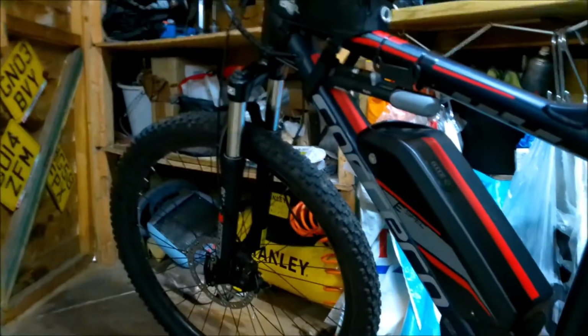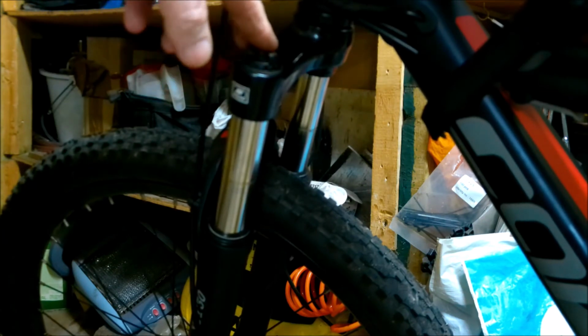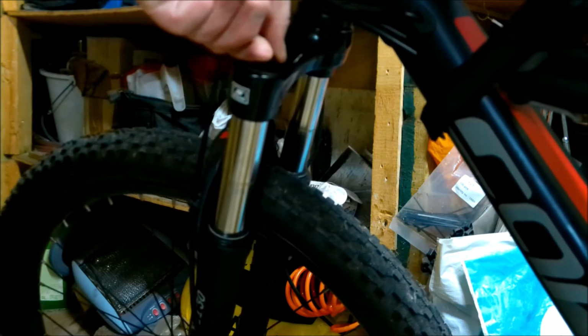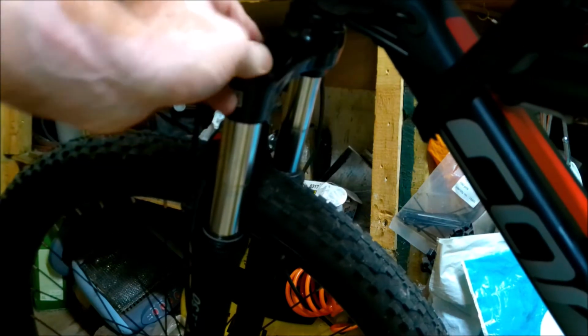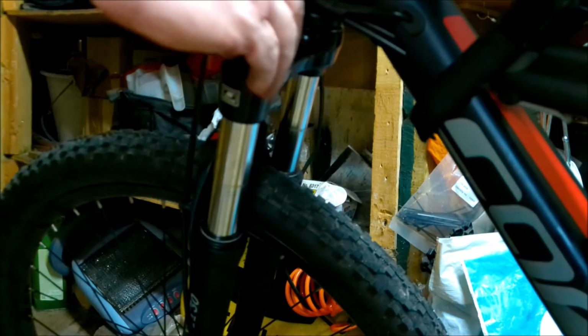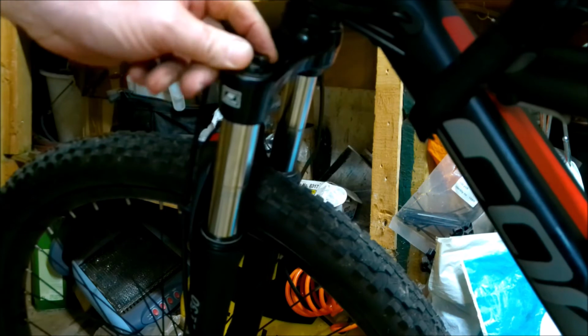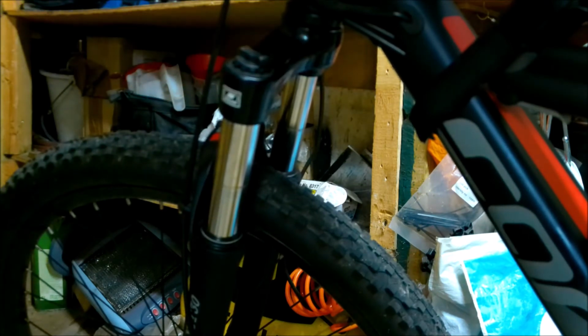That's about it really. The front forks are adjustable. The front forks are adjustable, so if you're on the road and you want it a bit more sturdy, because you're obviously not hitting, well, I was going to say you're not hitting as many bumps, but obviously English roads, it's all a bit of a mess out there. You just turn the top to tighten it up, to give it less dive, and do them both the same. They're not joined, so get them both the same.